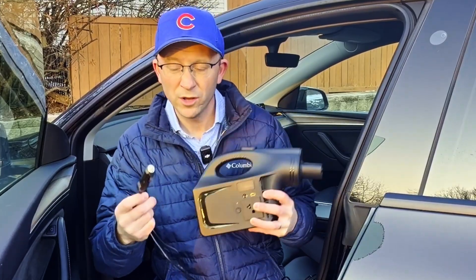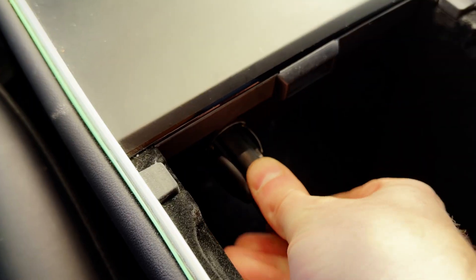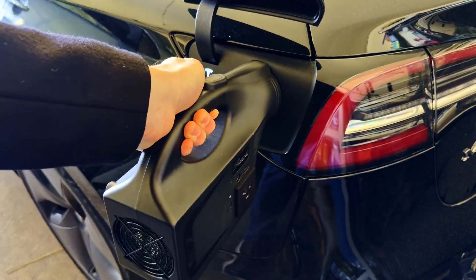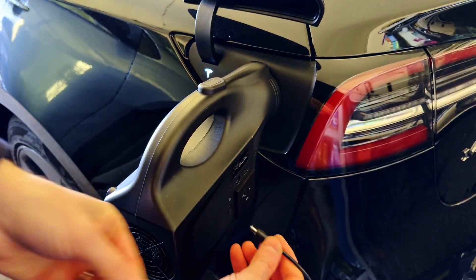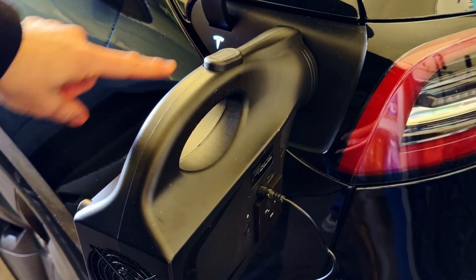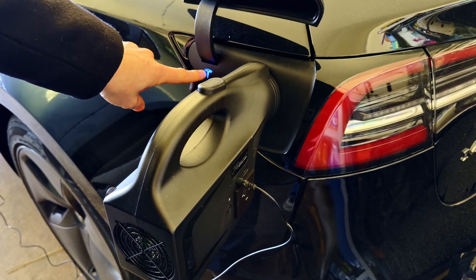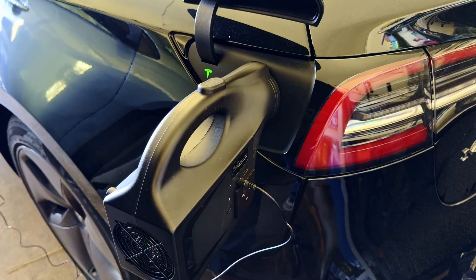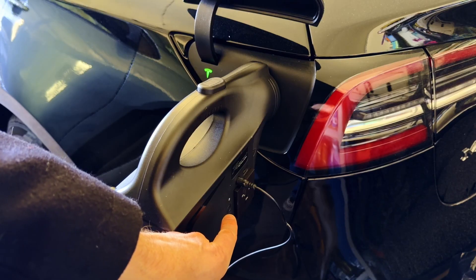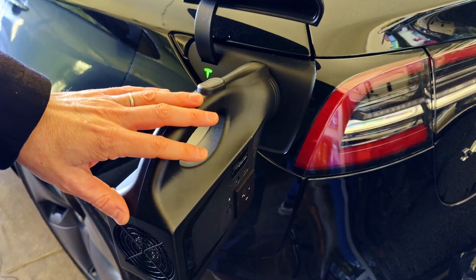The second thing you need to do is make sure your charge limit is higher than your current battery level — as long as that slider is higher, you'll be able to use the V2L. There is a long cable that comes with the V2L. Open your charge port and insert the connector, then take the adapter and plug it in. The green light turns on; press the button and wait for it to turn blue and flash rapidly. It will then turn green, slow its flash, and after that you can remove the cable and you're ready to use the V2L. Note that it may not work on the first try.